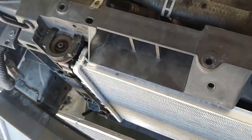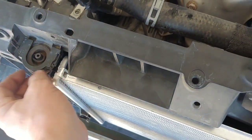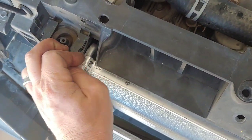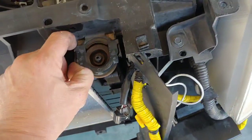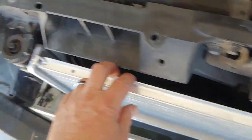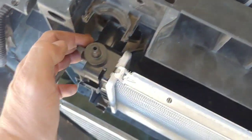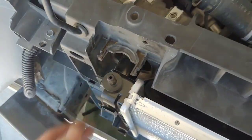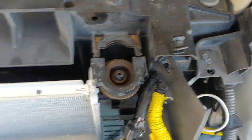One thing I forgot to do — I'm gonna have to go back and do it — is put the upper radiator hose on now. So I'm gonna disconnect the clips again so I can lean everything forward, take that off, and get in there. I can put the upper radiator hose back through here and get some vise grips on it to get a hold of that clamp so I can work the thing back on. I'll do that first and then re-attach everything.